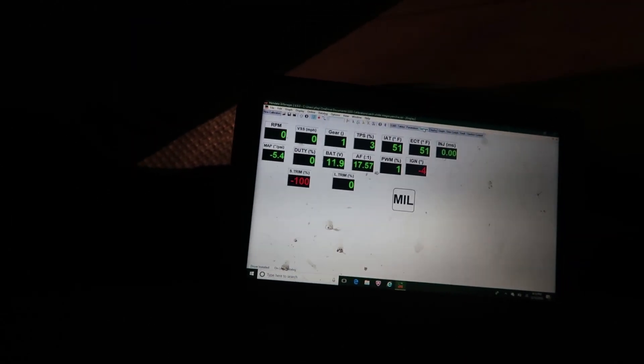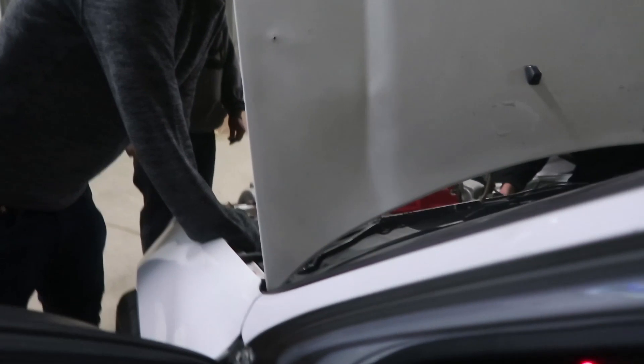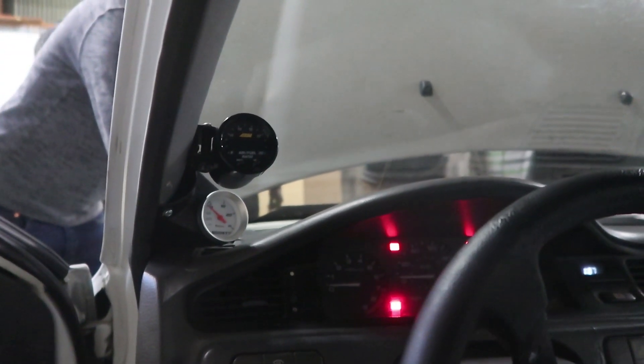You can see what our air is like - that's what we deal with, minus five. So we're trying to start it. They don't really know the injector size, so we start with thousands. We're going to just change this until we get it to run. When I change this size down, I'm increasing the amount of fuel that comes out of them.